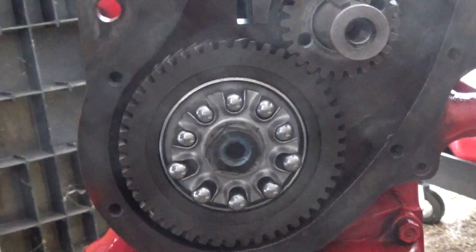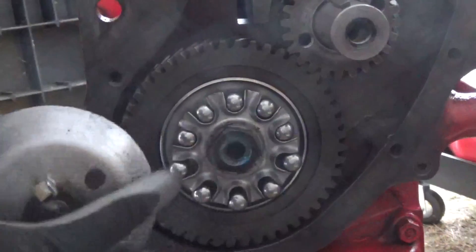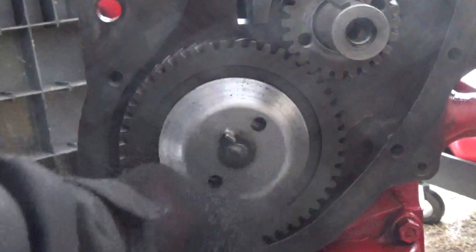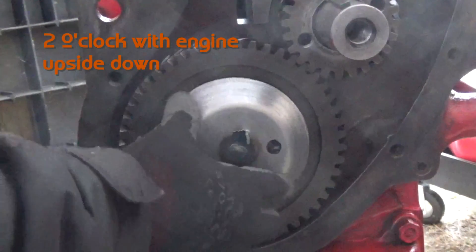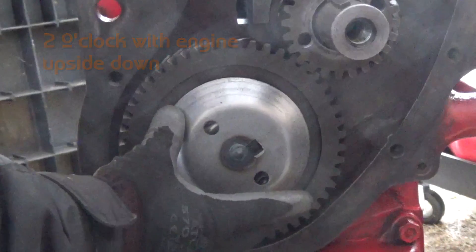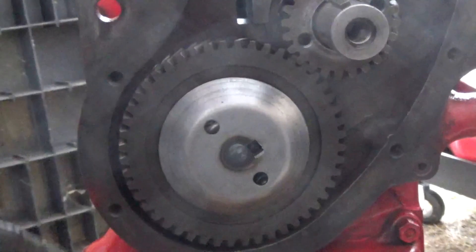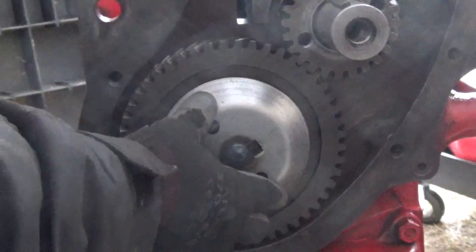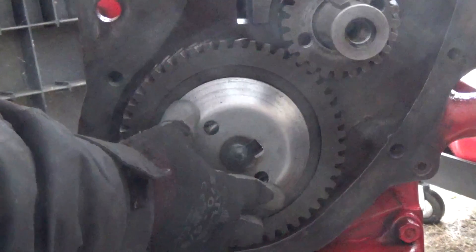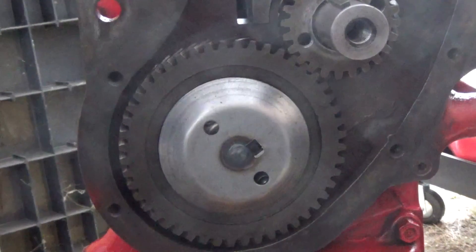This must be for a different model or something, but see those grooves in there — they don't do anything when you put it inside here. But when you put this in, what it says is that when the engine is upright, it's supposed to be at eight o'clock. So this right here should be at eight o'clock, which should be right about there. Not seven or anything before, or else it'll tear it up.